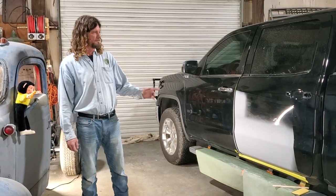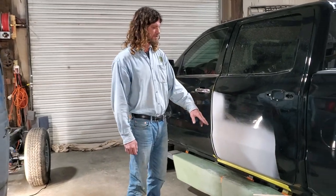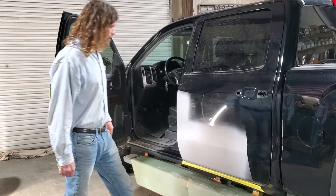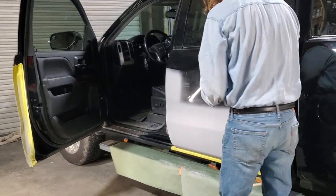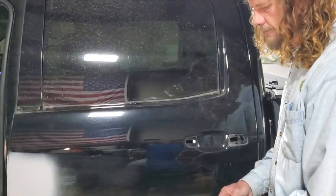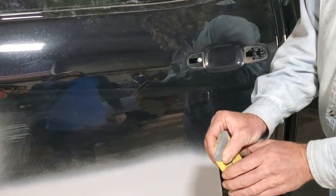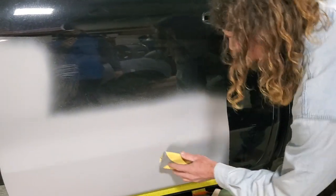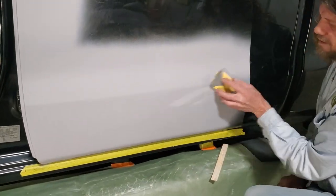Welcome to Effect Custom Uncensored. We're wet sanding now. We're going to start off with 320 and then wet sand 400. Most body shops just do dry sanding strictly for the time. I have a semi-hard block, a wet sanding block — it's kind of stiff but kind of smushy. Start off with that with 320. Sand and block all the same way in cross sections like this.